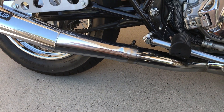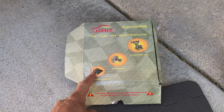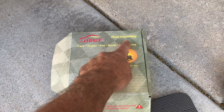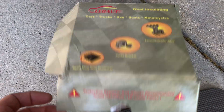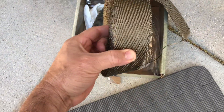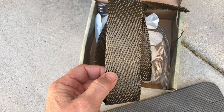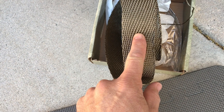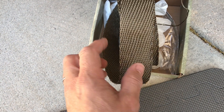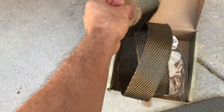I'm in the driveway today with the CB750 and I'm about to put some pipe wrap, header wrap, heat insulating wrap. I got the titanium type, which is not fiberglass. This one is actually made from lava rock — it doesn't fade and offers a little more protection, lasts a little longer. It does fray a little more easily, but you can deal with that — that's what scissors are for.